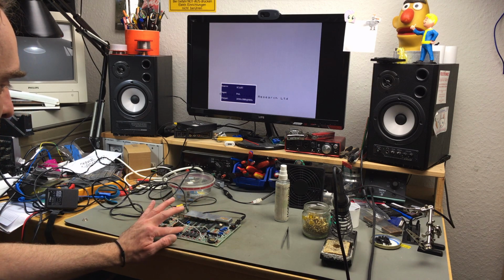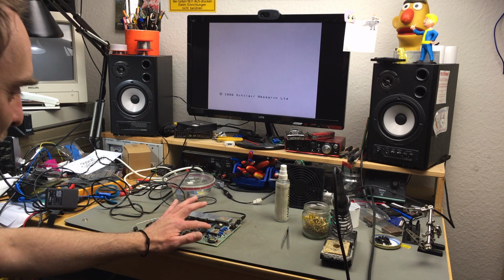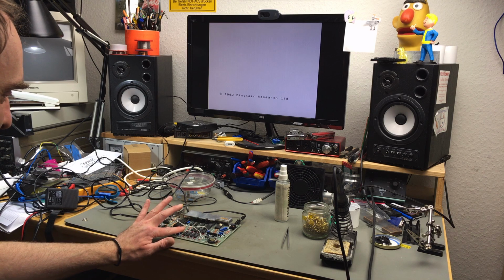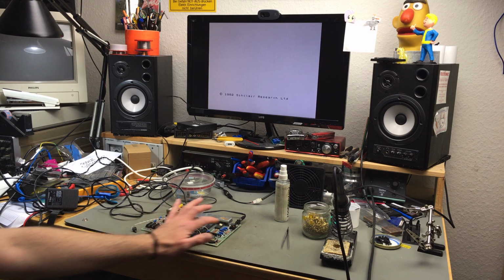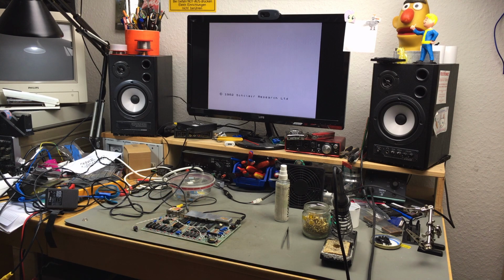See if any of the capacitors gets unnecessarily hot, which would be a clear indication for it being in the wrong polarity. And trust me, they get hot really quickly, usually. And if you leave them in too long, they burst, basically, or explode, because they short out and the electrolyte basically evaporates into gas, and it can be quite violent, actually. You've probably seen videos of people doing that on purpose, just putting capacitors in the wrong polarity. But this seems to work. Very good. To the case, I guess. It's getting really hot in here anyway, so I'm looking forward to playing with some water.